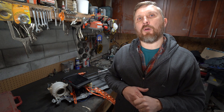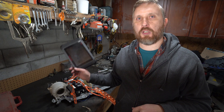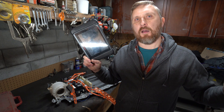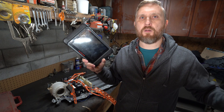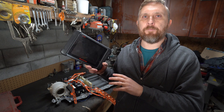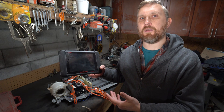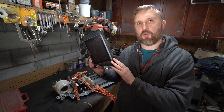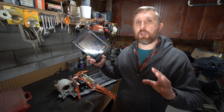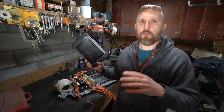To simplify your diagnostics, you'll need to go to a shop that has a more advanced scanner — not AutoZone scanners. AutoZone and Advanced Auto Parts have generic OBD-2 scanners that can check your check engine light, but they won't be able to go into the hybrid control system. Go to a shop with an advanced scanner — trust me, there are a lot of shops that will do scanning for you very cheaply, around $20, and some shops even do it for free.